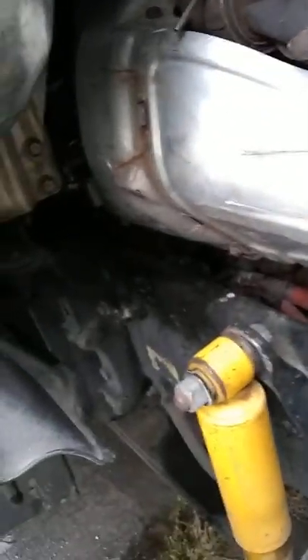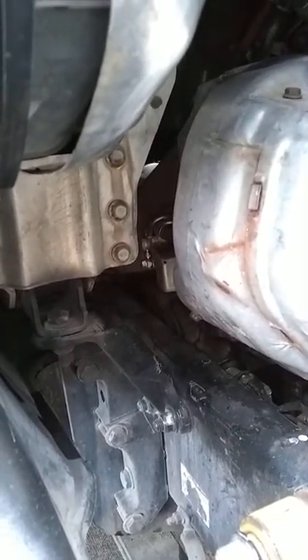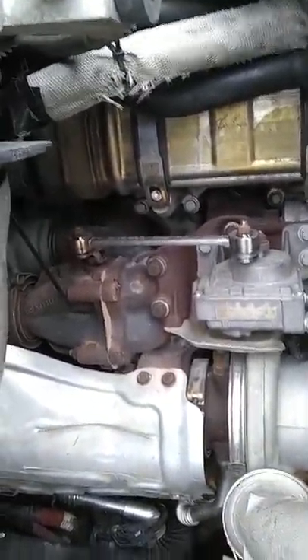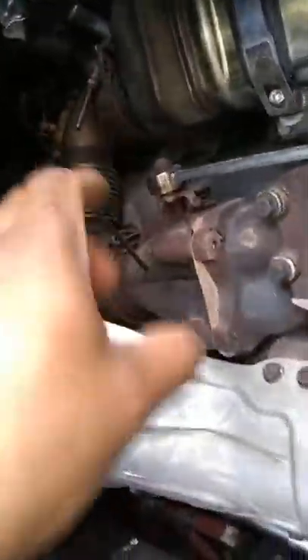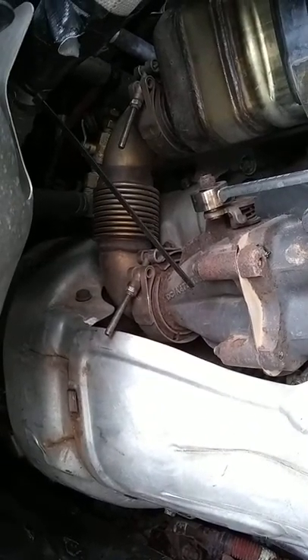What you're going to find is a coolant line that actually goes from your doser injector all the way up and comes to the back of this water manifold that's behind your EGR cooler. It's got an aluminum fitting on it, and if that fitting gets worn out — it gets loose from vibration — you're going to have two or three tab bolt connectors that actually keep that hose rigid.